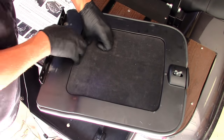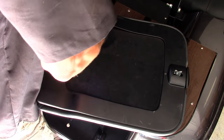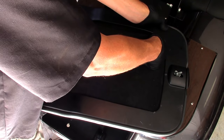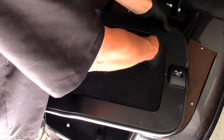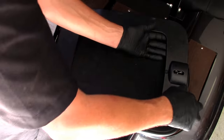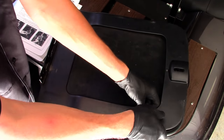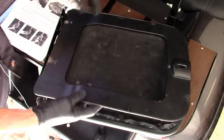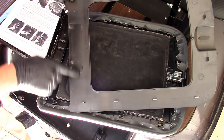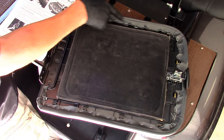Now I need to remove the plastic trim panel on the lid. Just grasp whatever area you can get your hand under and start popping it loose. Take a little bit of force — go around the perimeter and take your time. If it's got some age on it there's a possibility it could break, so be gentle. On mine, three of the snaps are already broken from a previous owner; otherwise they're just plastic fingers that snap into little plastic guides.